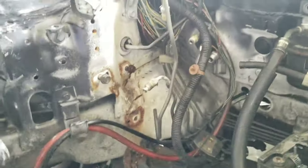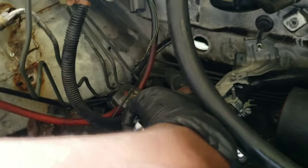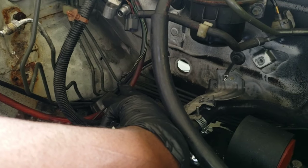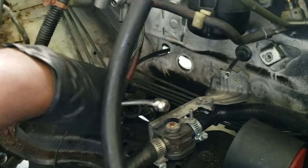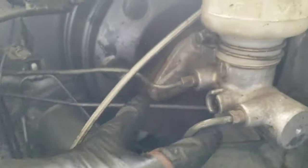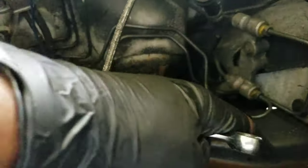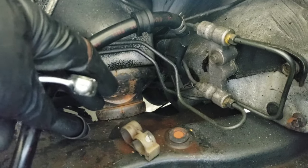All right, so after you get this out, if you're doing this with the motor in the car, it's probably going to be a headache. But it can be done if you have patience. So there's a 10 down there in that corner. And of course, the ones along the back wall. Once you get those loose, take off the two here that go to the master cylinder. And then take off all the lines down here on this H-shaped